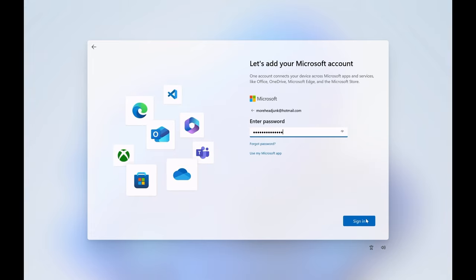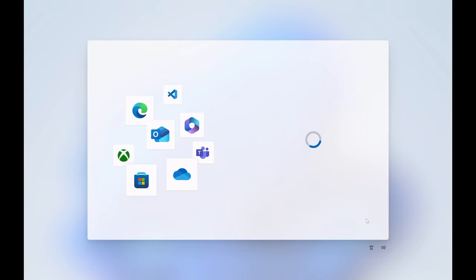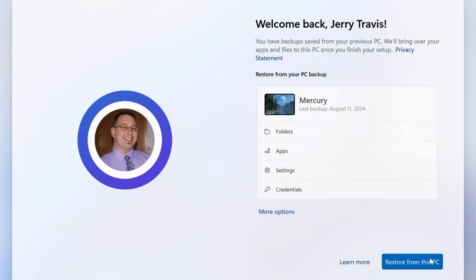This is wanting you to sign into a Microsoft account. If you don't have one, you can create one for free and I recommend doing that. A lot of times your university or school will give you credentials that you can log in to Microsoft with, but I recommend not setting up a new laptop that you own that way — because if you graduate or drop out of school, you're going to lose access to that account. My Microsoft account has two-factor authentication, so I'll take care of that now. We're going to set it up as a new machine, not restore from a backup.